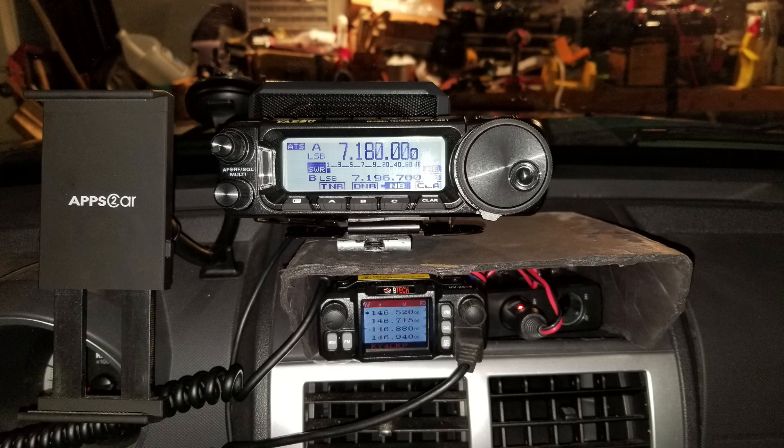I was going to need to change where I was connecting for power. The Baofeng at 25 watts I could just plug into the 12-volt accessory adapter inside the vehicle. But for the new radio, I needed to go straight to the battery, just like I had done for the FT-891 that you saw in the previous video. I was also going to need to rearrange how I had things configured on the dash, since the AnyTone is physically a lot bigger than the Baofeng. So I'd be redoing the connections to the battery, putting in some Anderson PowerPole fused pigtails in the engine compartment.